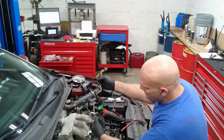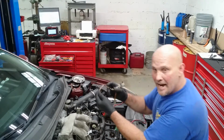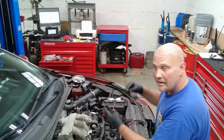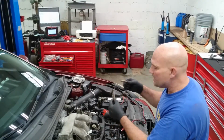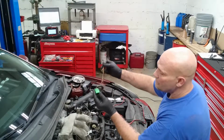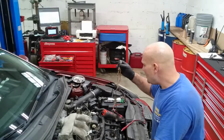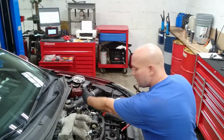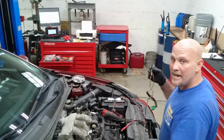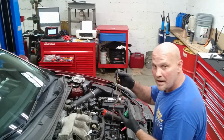So it comes across, then you have shielding at every position in which this harness, if it were in there, would be touching something else. So it's actually kind of like a vibration deadener. That coming up, you have one connector which goes to your bank 1 cam position sensor, which is, there's bank 1, bank 2. Bank 1 will be with cylinder 1, which is the rear bank on this one. The front bank is bank 2 because it's cylinder number 2. It's delegated through the cylinder, through the spark timer.